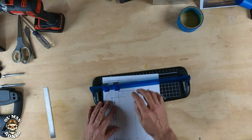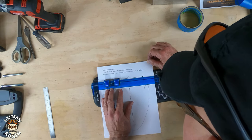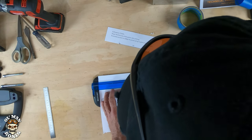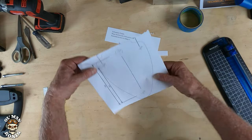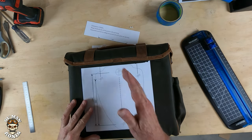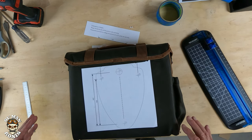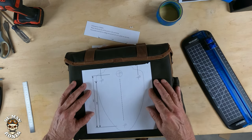I made several copies of the template in case I mess up. I try to get it exactly lined up — the little arrow with my cutting surface — and follow right down that line. I also want to find the bottom reference point. Then I place the template on the back of the saddlebag and try to find the direct center. I found that the measurement I want is exactly six and a quarter inches, and I'm measuring to make sure the dead-center line is six and a quarter inches and directly in the middle.